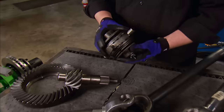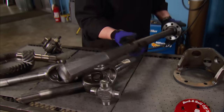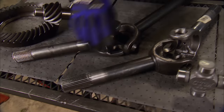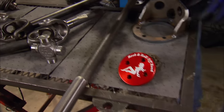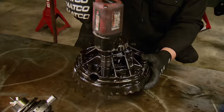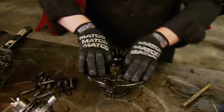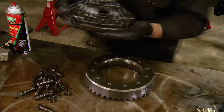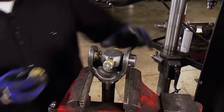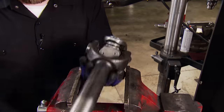It's going to start inside the differential with a Detroit locker that'll turn a set of 5.38 gears that we got from Yukon. Those in the rear will turn a set of Yukon cut-to-length chrome moly shafts. Up front, we had a set of Yukon shafts custom splined by Hudlow Axle. We'll join those to the outers with a set of CTMU joints, and then finally at the wheel we'll use a Rock and Roll Off-Road drive flange. The Detroit locker will provide ratcheting action when turning but also give us 100% traction when wheel spin is detected. The 5.38 gears give us a final crawl ratio of 88:1 when the transfer case is in low range. CTMU joints are great insurance — their heat-treated 300M cross and rebuildable bronze bushing is one less item to worry about on the trail.